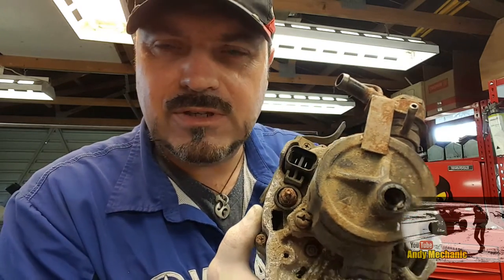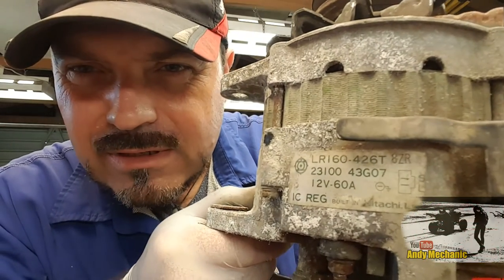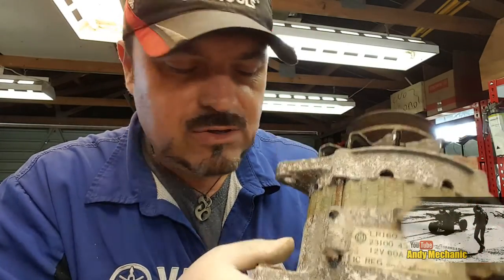Sometimes there are some discrepancies. On the old safaris, we had a 24-volt one we scrapped and the splines were a bit different. So there are two or three different types of vacuum pump and they are specific to the alternator. The alternator I've got here is only a 60 amp — it's not particularly great. So if this fails as well, what I'll be looking to do is sourcing an upgraded alternator, something like 120 amp would be fantastic just to run the electric winch properly and recharge the battery after using the winch. Because a 60 amp alternator, it's not a lot really.